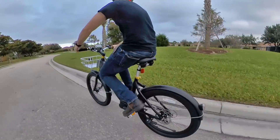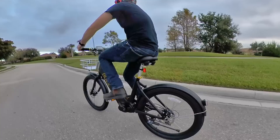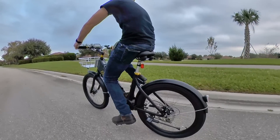This is also the reason you won't see regenerative braking on mid-drive bikes, and I see this question a lot: why don't mid-drives have regenerative braking? It would make so much sense. The problem is they usually have either a spring clutch or a freewheel in the mid-drive motor, which means the motor isn't spinning when the bike wheel is turning without any electricity being applied. So you're not getting that parasitic loss, but you're also not getting the ability to do regenerative braking.